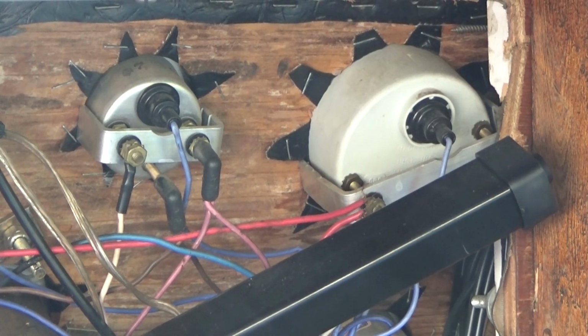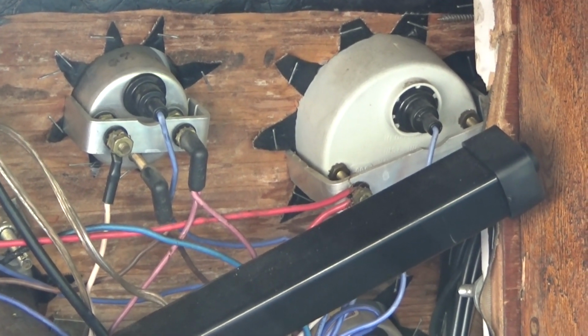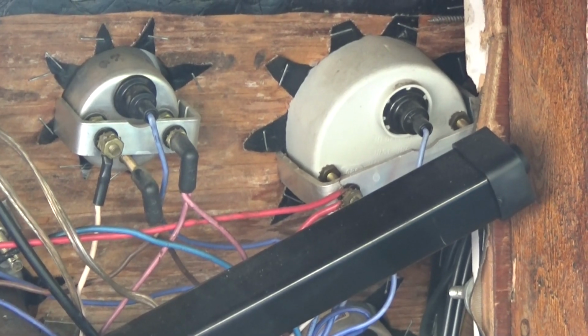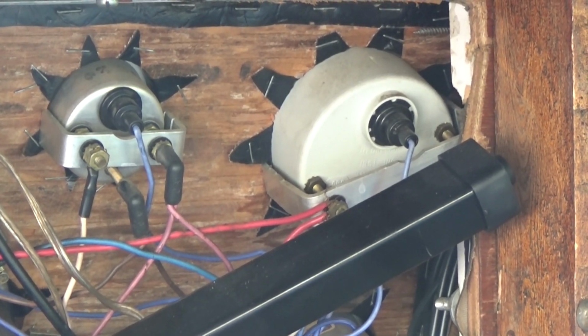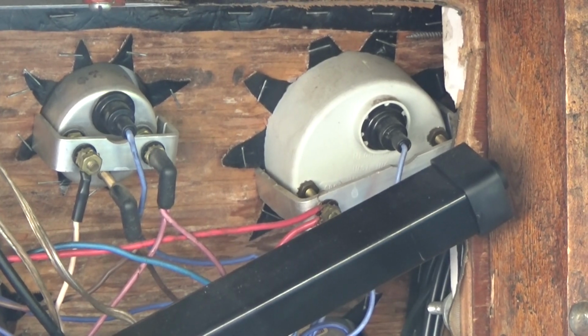I tried digging into the rear side of the 1970s tachometer and adjusting it, but it just made things worse. The adjustments kind of went all over the place. Every time I turned the little set screw, it would either peg at 6,000 or jump back down to 0, and it's just really inconsistent where that goes. So I think we're going to rip that particular gauge out and get a modern one to replace it with.